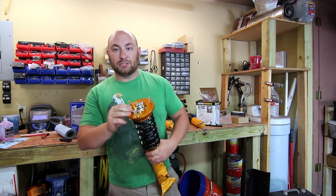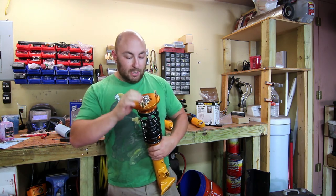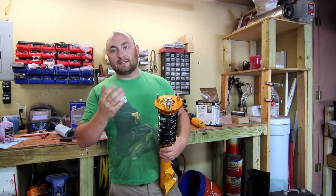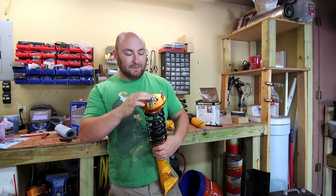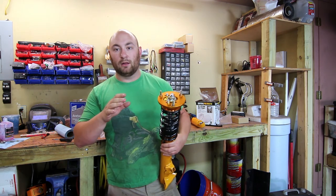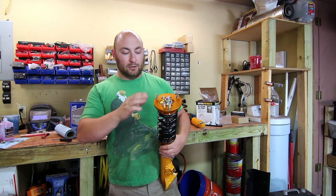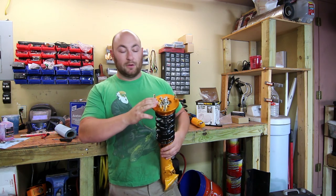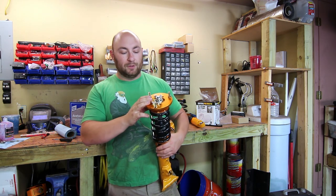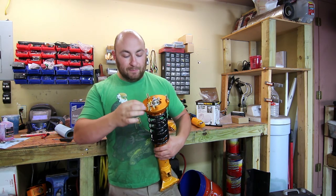Let me walk you through the design. This is a front unit. Starting at the top, these came with fully adjustable camber plates — they have a spherical bearing in them, which is a nice premium feature. If these are quality materials they'll last and perform just as well as three or four hundred dollar adjustable hats on their own. If it's crap, it gets burned up and you're better off with rubber bushings.